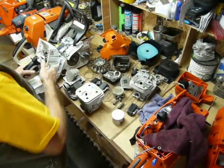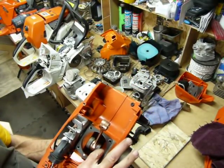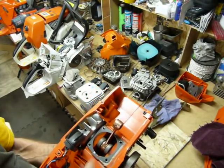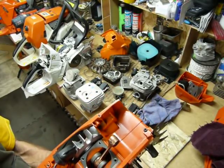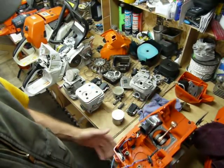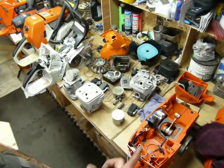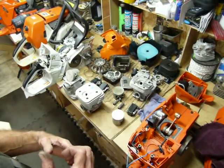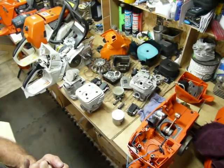The 395 is old school, but it's actually pretty small. The volume right below the transfer ports — there's a little bit so it'll get rolling. The crank came out of the 288 when they redesigned the saw — they didn't make a new crank, they just pulled it from the 288. It does have a really nice long rod though, so you've got good dwell time. You want more dwell time — that gives you better actuation of the burn effect on the top of the piston, which is sweet.